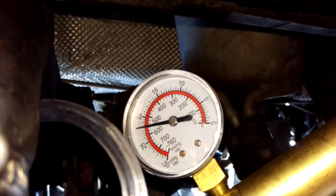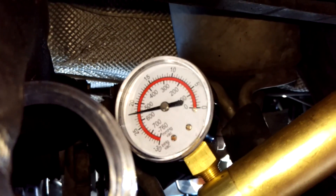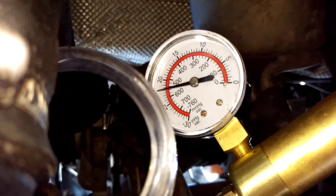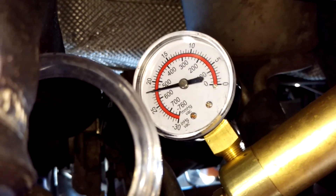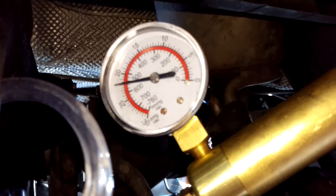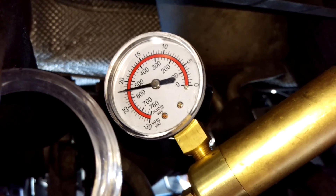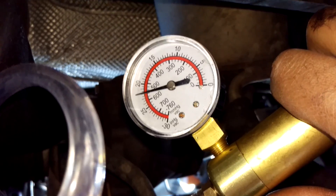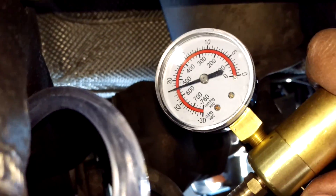And it really is as simple as that. So if the arm isn't moving through other means, then have a look at maybe a boost solenoid - maybe you're losing vacuum through there, or a vacuum pump. You're not building up vacuum. But definitely get a hold of one of these testers because it just eliminates guesswork very, very quickly. And I hope you find that useful.